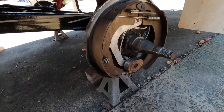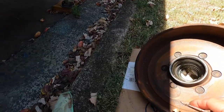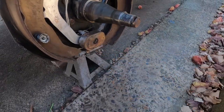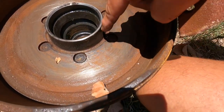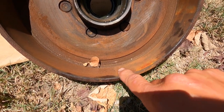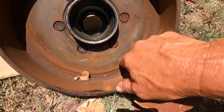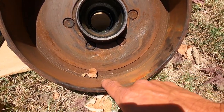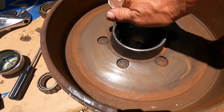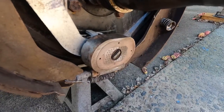There's a bit of rust on that magnet, so we'll give that a good sand. And we'll also do that to the inside of the drum — the contact point of that magnet. It seems to have been a rest point for the magnet, and it just so happens to be where the big rust is on the inside of the drum. I reckon that's where the caravan rested for the three weeks on the beach after the initial saltwater crossing. To be honest, the first time I hooked up coming off the beach, I felt I was dragging for a few seconds.